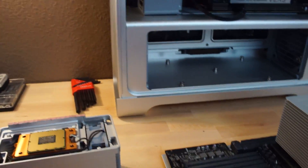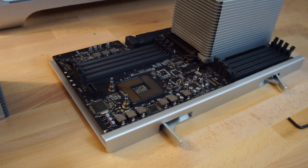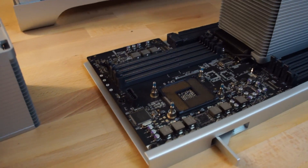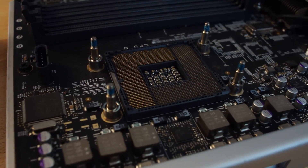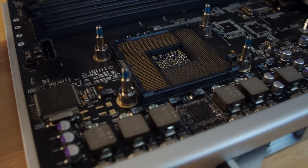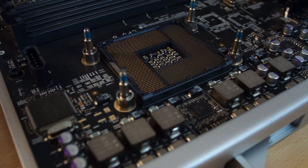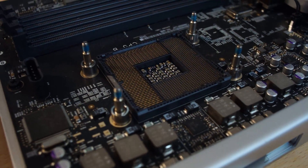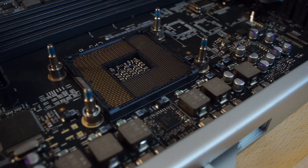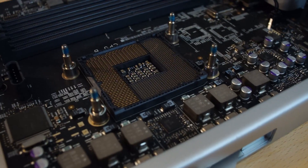If you've never done an upgrade to one of these towers before, it's not exactly for the faint of heart. The CPU mount is unlike most in that there's actually no retention bracket on the CPU socket. When you're doing this kind of upgrade, you want to be really careful not to bend the pins. That's something that can ruin this board, and these boards are quite expensive — upwards of $300 to $400 if you ruin one on the dual-socket system. So just something to keep in mind if you're a novice to this process.